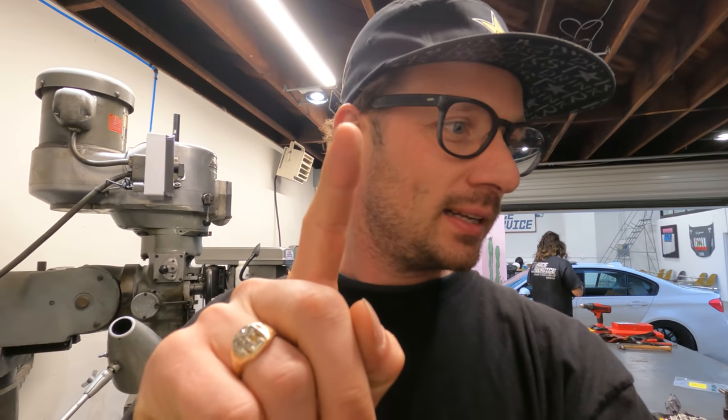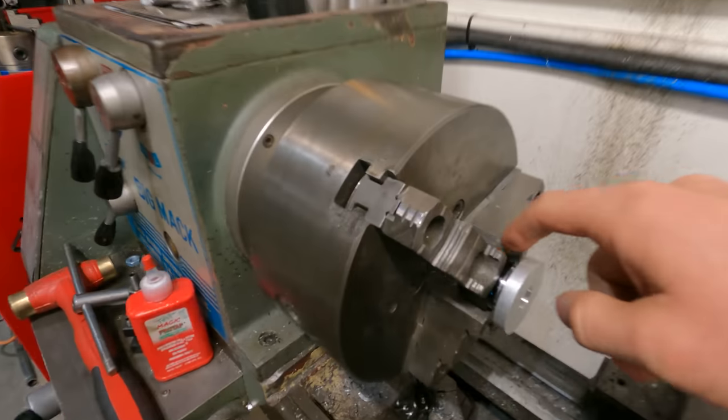All right, we're back here at race service. Dom is jamming on the one that he was able to finish and put threads on. So right now he had to cap the threads with an AN cap and then bolt it into the chuck on the thread side so that he can now cut, trim, and then eventually put it in the mill to trim the base on it, or cut the base on it.